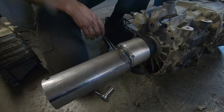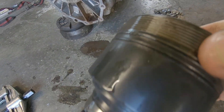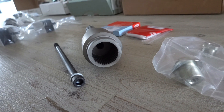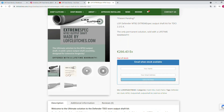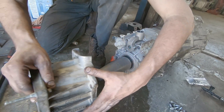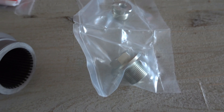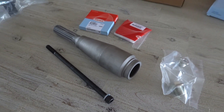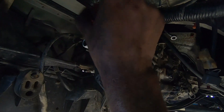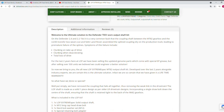For these reasons, we decided not to go for the third version of the part sold by Ashcroft. Although they have probably corrected some of the flaws, we decided to go for a part built in one piece: the Xtreme Spec MT-82 output shaft kit from LOF Clutches. The LOF shaft is made as one single solid piece, which eliminates the additional part and minimizes the risk of failure. There's also no possibility of a leak because the gearbox oil no longer communicates with the part at all. In addition, they provide an easy-to-store small tool for the install and disassembly. It's quite unbelievable that Land Rover didn't think of installing this kind of part from the beginning. Did I tell you LOF Clutches offers a lifetime warranty on that Xtreme Spec MT-82 output shaft kit?